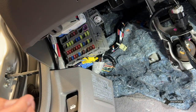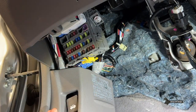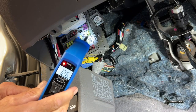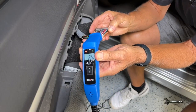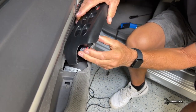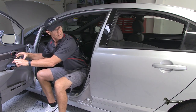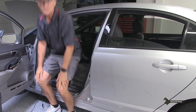So let's remove the fuse. I have a new one to replace it with. Let's recheck the fuse — we got good on there. With my new fuse in, let's go back to the purple wire and now we've got power there. Let's plug it back in and test our window. Now the window works. Perfect. Now let's see if the rear switch works also.